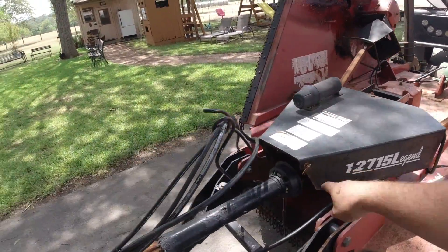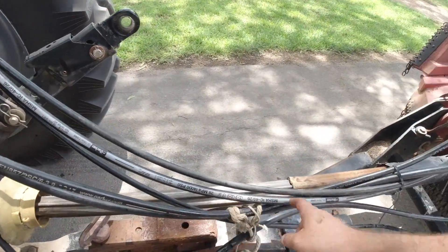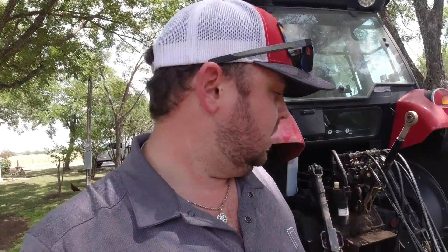The front's got two new seals, and I did have to get a new tube put on here. The last one was bent — it was bowed a little and it was enough to throw that driveline around quite a bit, so I just opted to get a new one. The tube was like $100, no big deal. Everything else runs real smooth. I'm a little worried about that leak, but it'll probably seal up once we start using it.